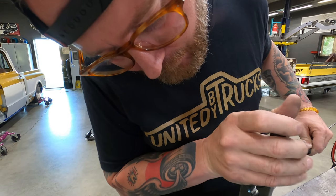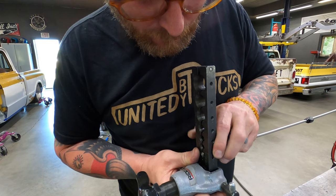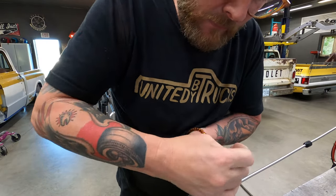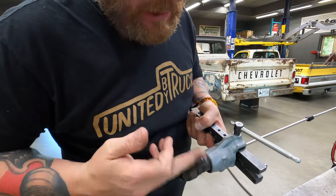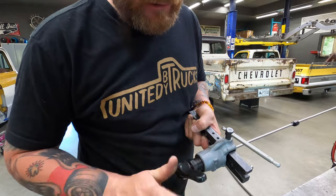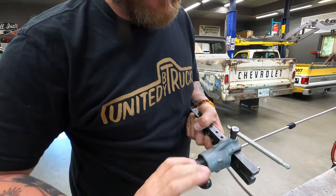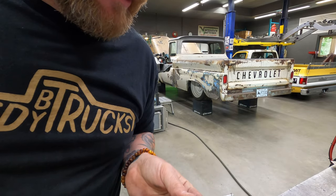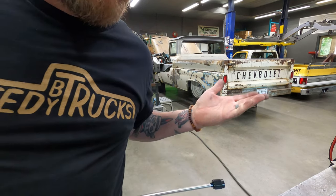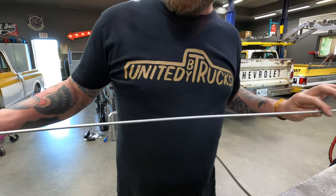This is one of the higher-quality primitive benders — simple, you just put the line in there, tighten it up, it clamps and holds it, then you tighten it down and it flares it, back it out and you're done. Eastwood makes the best bender but I don't have the 37-degree dies right now — I did order them. Once you put the flare on the end, the tube sleeve backs up against it and allows the nut to tighten the hard line up against the AN fitting. Next you just make the bends precisely where they need to be, or you trash the stainless hard line.